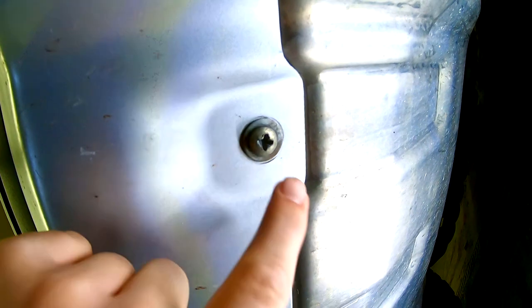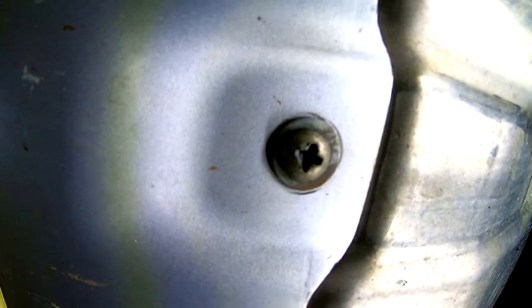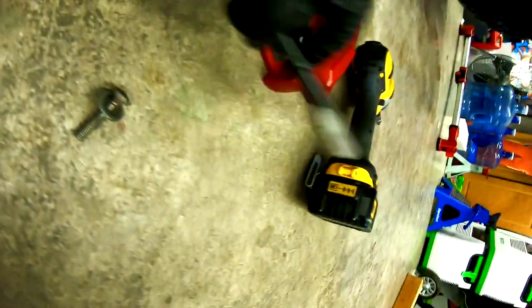All we got to take out is this forward plate here. This rear plate isn't going to have to come out - that's underneath the engine, the oil and stuff like that. Some yahoo removed the two bolts that go there, so the only thing that's holding this plate in is just these Phillips head screws right here. So when those two things come out, this pan comes down and it's freaking heavy. Just got to grab the biggest Phillips you've got in the drawer and knock these suckers loose. One thing that complicates matters is on top of this bolt, on the backside of that plate, you've got a nut with a washer on it. So you have to reach your arm up on top of the plate to get a socket wrench in there to hold onto that bolt while you're undoing this one.